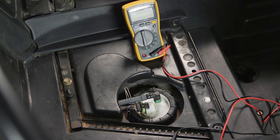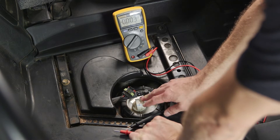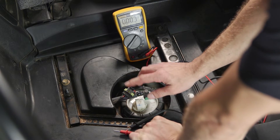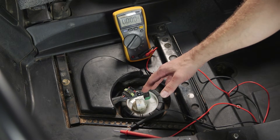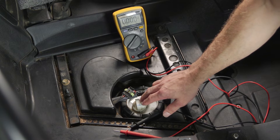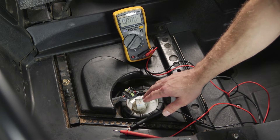We measured 12.5 volts for a couple of seconds and then it went back down to zero — that's exactly what you want. If you don't see this voltage, then you want to check your power and ground wire. A good place to start is at the fuse box. Now that we've checked for power, we'll want to check for continuity throughout the fuel pump, and this is a good idea to do whether or not you had power coming down to it.